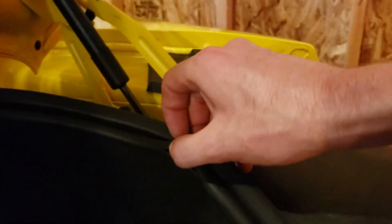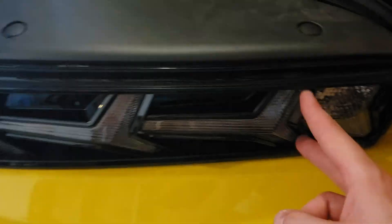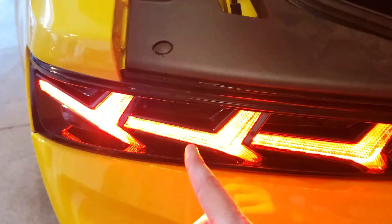The install was very simple. There are three pins on top of each access cover, and then you pull the carpet back. There are three studs on each taillight — two right about here and one somewhere right in here. Put the ratchet back behind the carpet and in you go.